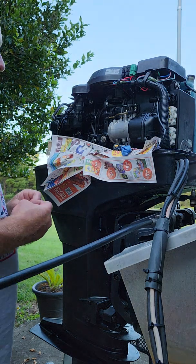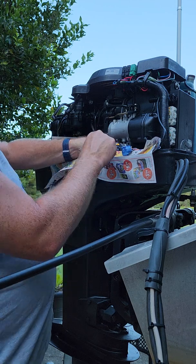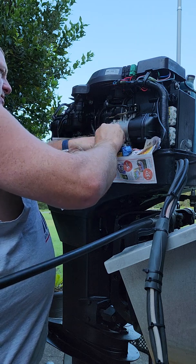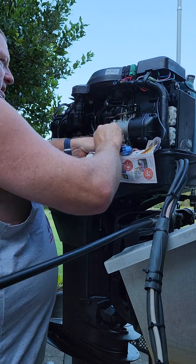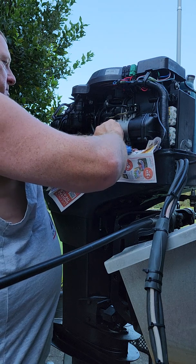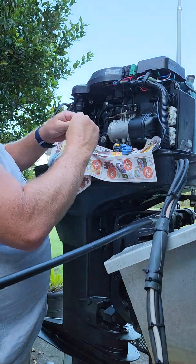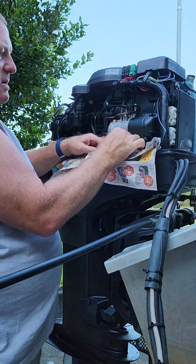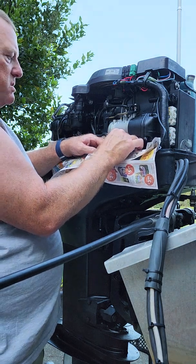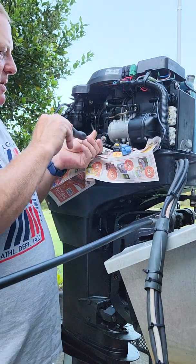You don't want your top lower than the bottom. You don't want it sitting tilted — you want it kind of level, because the engine is going to actually see its position where it's located. It'll recognize it because it's a throttle positioning sensor — it wants to know whether the throttle is open or closed. So just try to make it square.